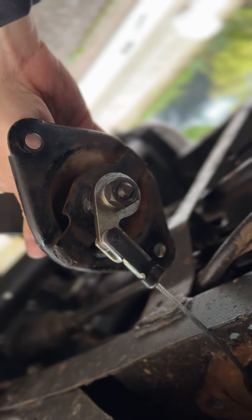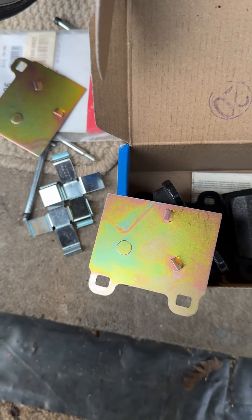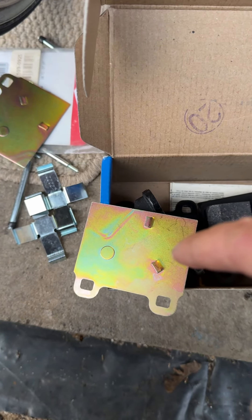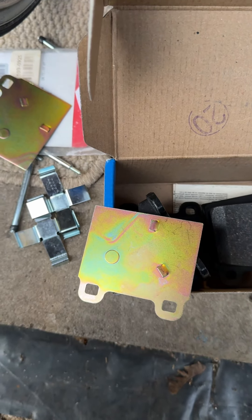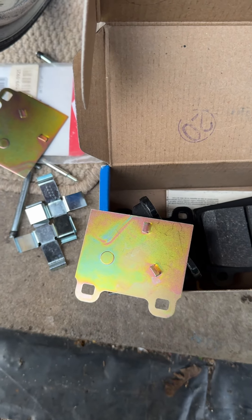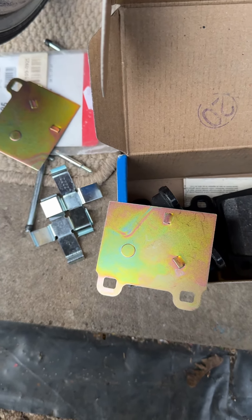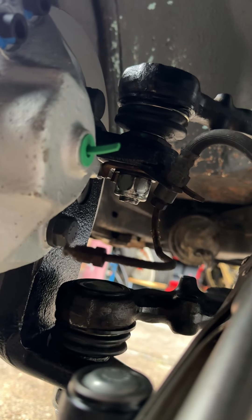There's the new clutch cable and my new clutch lever, all ready to go in. So frustratingly, I cannot fit the pads onto the calipers, as the seller only sent me two backing plates. I ordered this brake conversion and it didn't come with a pad fitting kit at all. They've kindly sent out the pad fitting kit, but unfortunately I'm missing two of these anti-squeal plates, and I'm not sure which way around these tabs are supposed to go. So at this point I'm calling it a day.